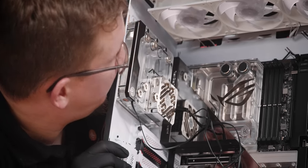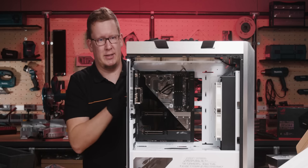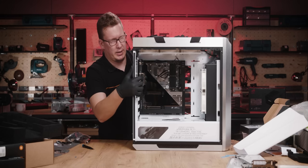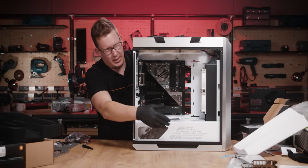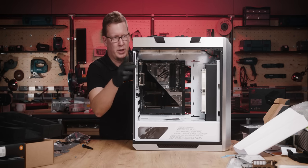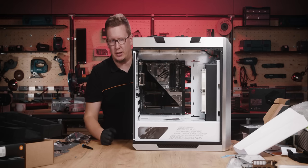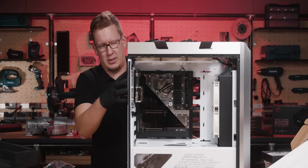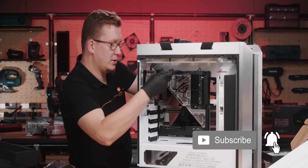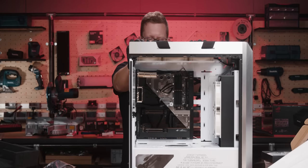My ingenious plan hasn't worked out the best way. The reason I went for this distro plate is because it really acts as a small distro plate — I wanted to connect the upper two ports straight to the motherboard, and use the other two outlets and inlets for the GPU and the radiator. The issue is that the distro sits higher than the motherboard. I can demonstrate it — it's probably now visually more clear that the distro is higher than the ports on the motherboard.